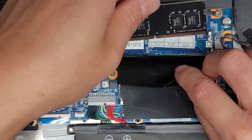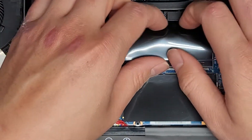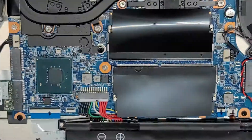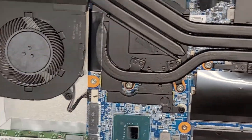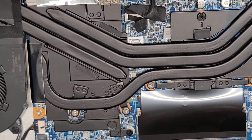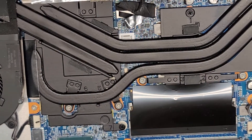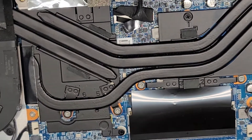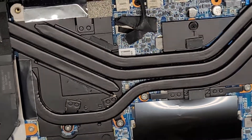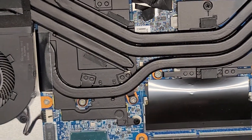I don't know if this RAM was upgraded after the fact, because Team Group RAM I usually see is an aftermarket purchase. The CPU is here and the GPU is here — they are both soldered to the motherboard. Everyone keeps asking if they can upgrade it, and the answer is: unless you have access to expensive hardware tools to heat the whole chip up, pull it off, reball the solder, and put a new one, the answer is no. You could also find a motherboard with an upgrade and swap that out, but for most people it's not going to be worth it.